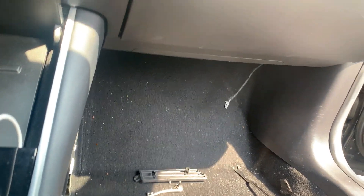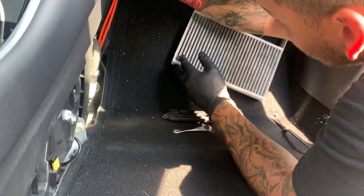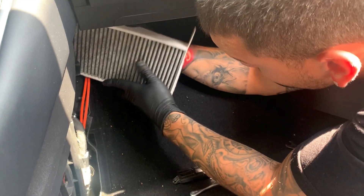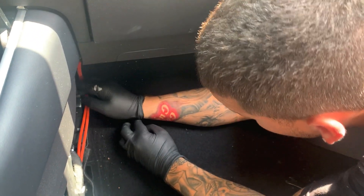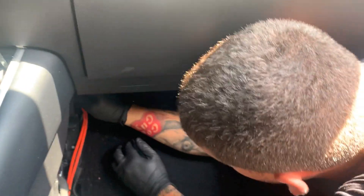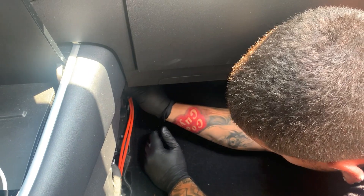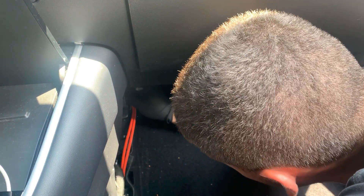When you do the coolant treatment, the air conditioning should be off. Then he puts in the two new filters, one next to the other. After that he puts back the plastic door and screws it back in — just two screws, very simple. Really a do-it-yourself job; you can order those filters from the Tesla shop or anywhere else.